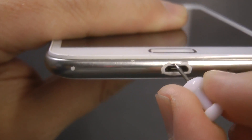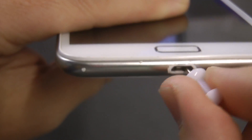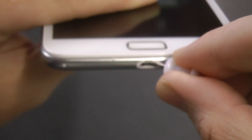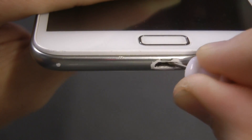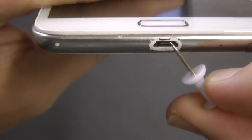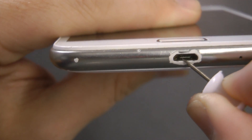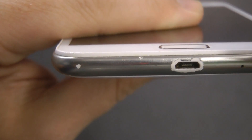Inside there are a couple of little switches that tell your device whether it's plugged into USB and it's charging, or if it's plugged into a dock and it's going to go to music mode. So you need to just give the USB connector a little rub on the top and possibly on the bottom — and that usually fixes it.